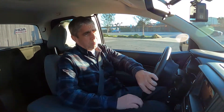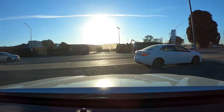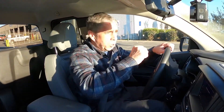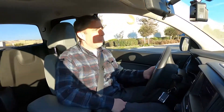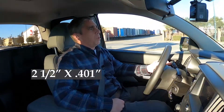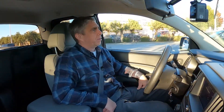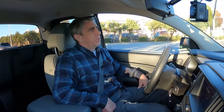I'm going to head home and wait for them to call. I'm back in my truck now — they did the work for me and I'm really excited about it. I took a quick look, and essentially what they've done is they've added two leaf springs on each side. They're two-and-a-half-inch wide leaf springs. I've probably got about two inches worth of lift on the rear axle.